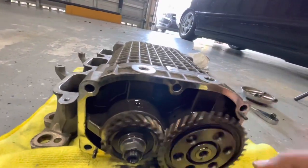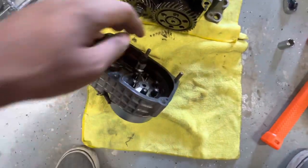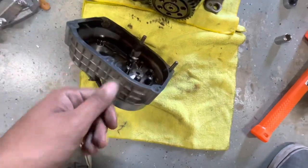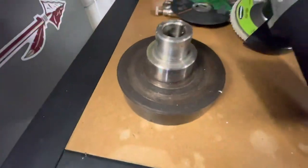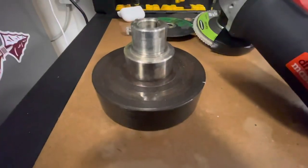The rotors are driven by this. The issue is you see these two bolts — you cannot get them out without first taking off the clutch pack, which is right here. This isn't the clutch itself, this is just the magnet part — the part that attaches to the clutch on the pulley. But in order to get that off...